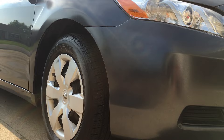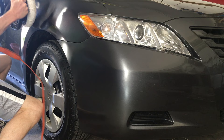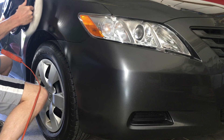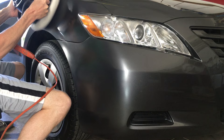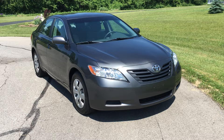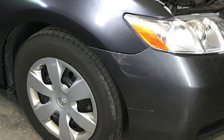The clear is dried — look at the original paint on the front of the bumper compared to the dull paint on the repair area. Wet sanding and polishing is a step for any paint job to look perfect, including do-it-yourself aerosols. The orange peel isn't even bad enough that I need to wet sand. Because lacquer paint is soft compared to urethane, especially when it's new, I only need to polish it to get it to match the original paint. I apply some cutting compound and buff the paint using a terry cloth pad on a low speed orbital buffer. An expensive variable high speed buffer isn't necessary when you're polishing out lacquer aerosol paint. You could actually polish this by hand if you wanted to using a terry cloth and some polishing compound, but if you have a large area it's a lot faster to use the buffer. After polishing, I let the car sit in the sun for a couple of days to fully cure the paint, and then put a coat of wax over the new paint to seal and protect it.